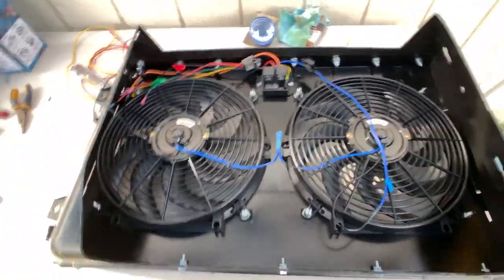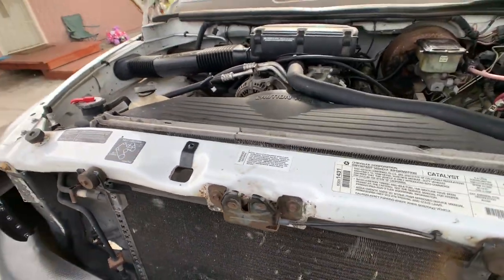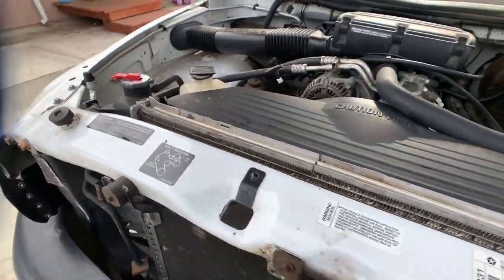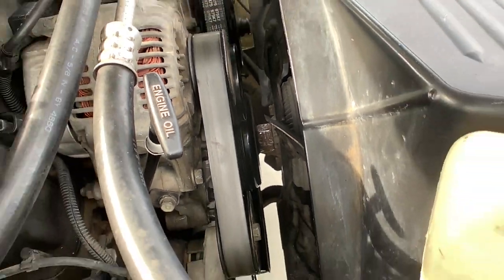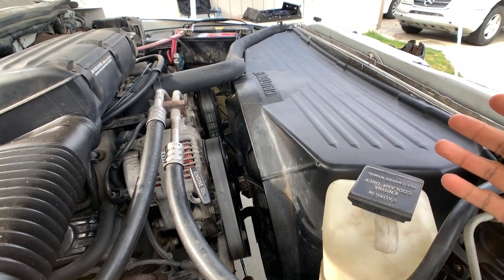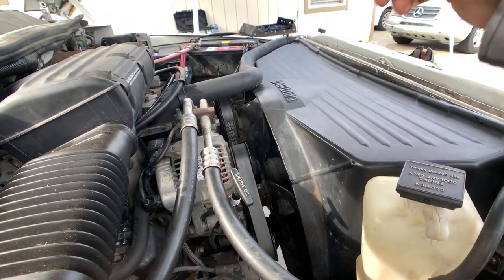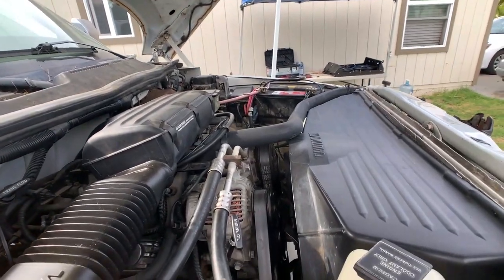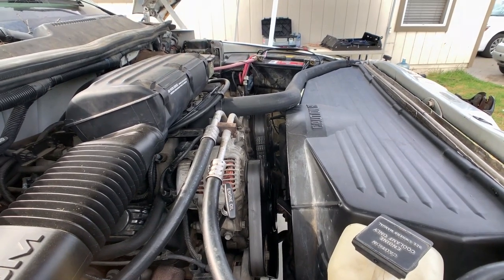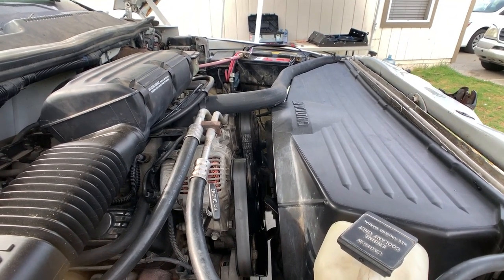What I'll be doing is installing this kit and removing this elephant of a radiator fan. I'm getting rid of it because, one, look at how big this thing is — it's an eyesore. Two, if you look down there, that's a clutch fan. It steals power parasitically because it's attached to the motor; when the motor turns, it has to spin those really heavy fan blades, which takes some power. This doesn't give you horsepower — it frees up horsepower.